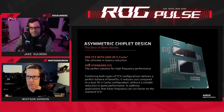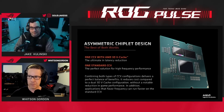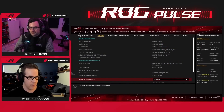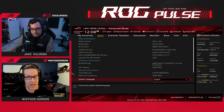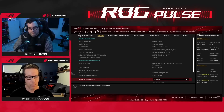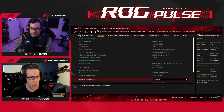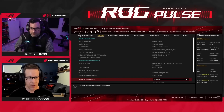Make sure you download the latest BIOS and the latest chipset drivers, and you should be good to go. Also, apart from the up-to-date BIOS, you want to make sure that you have Xbox Game Bar installed and up-to-date, because that's actually what AMD and Microsoft are using to determine whether a game is running and whether it should be running on that CCX with the 3D V-cache. Make sure Game Bar is installed and updated — sometimes on a new PC you have to open the Xbox app and let it reinstall itself.